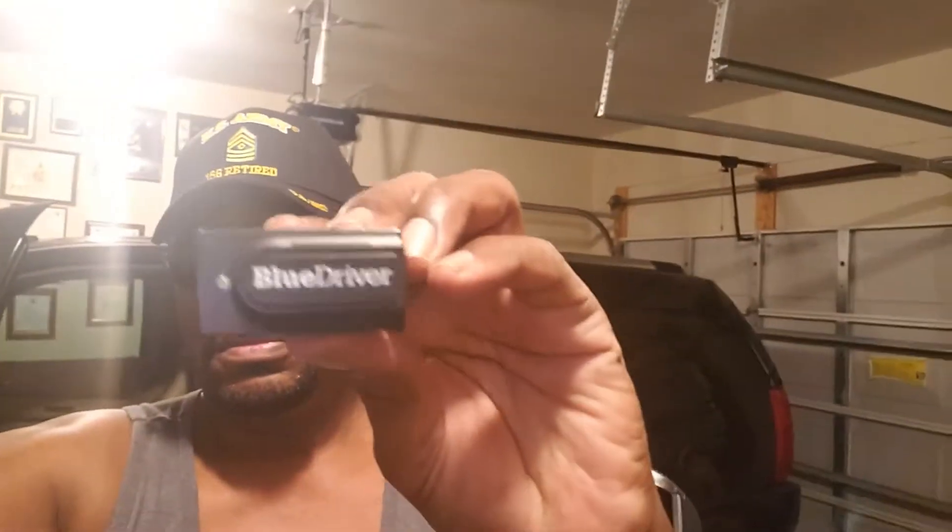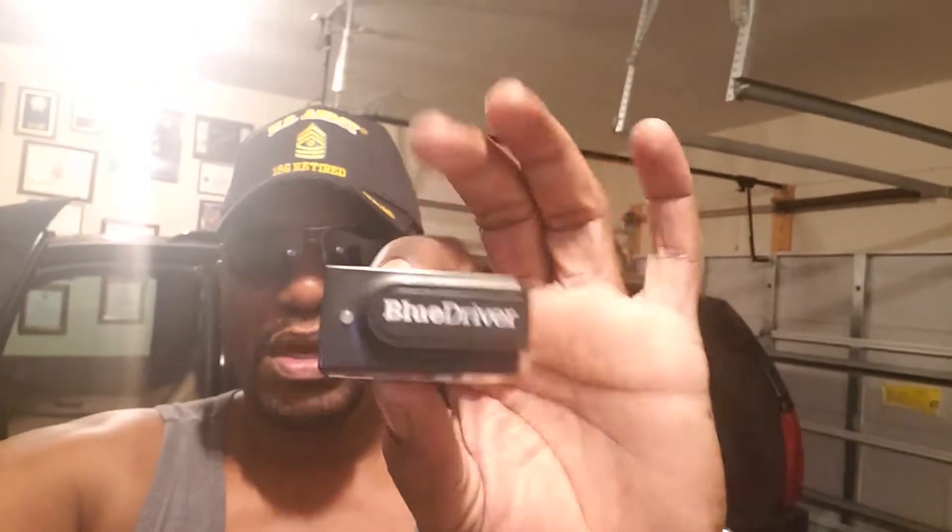Good afternoon. It's been a long time since I made an automotive repair video, and every now and then I make them because my truck throws a check engine light. It threw a code P0121 and it said the throttle pedal position sensor is defective. So the first thing I did was I took this little gadget here, my Bluetooth tester, plugged it in and it gave me that P0121 code.